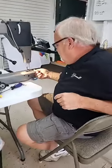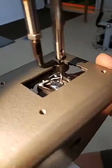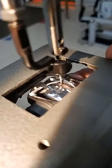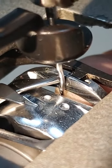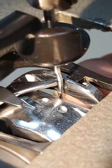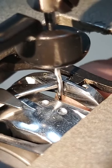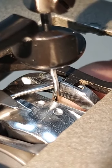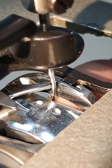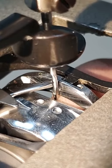So, Dougie, maybe you can see this. Back down here on the hook point, I'm going to grab the needle here at the bottom, at the point, and I am showing you what's happening when you're quilting a circle. Here's what's going on. You notice how that needle moves around. It pulls away from the hook. It moves into the hook. As you make that circle, this is what's actually going on with your hook and needle.